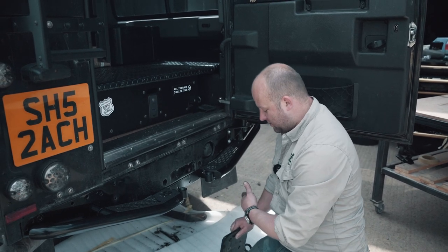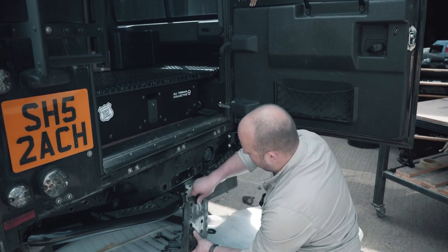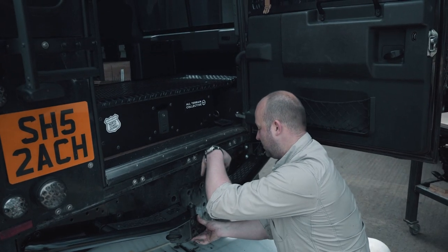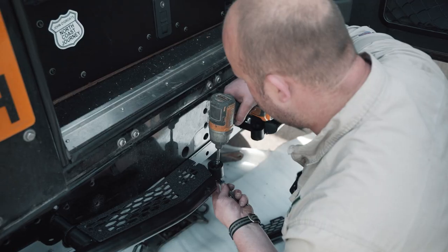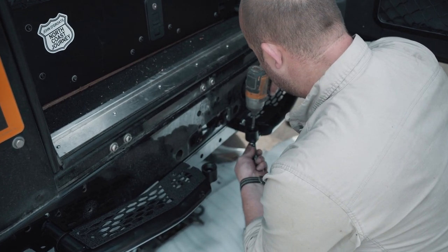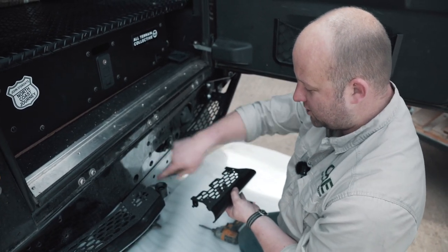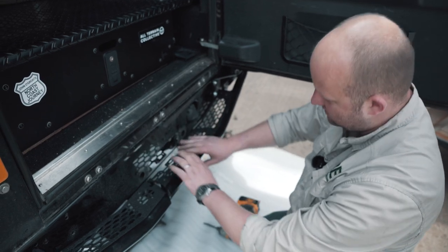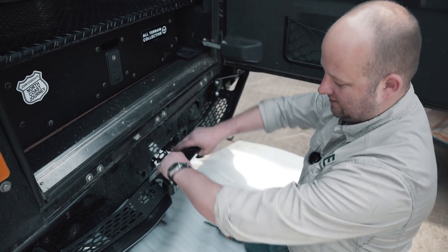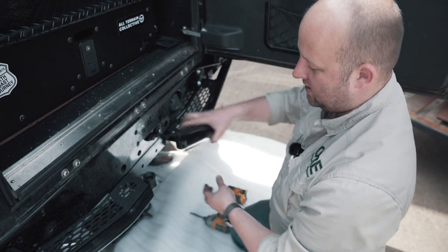If you put the factory tow system back on, your stays would still be in situ and you would simply put the bolt you took out back in exactly the same places, and the centre section will fit in around this. When you've set the slots — females this way and males that way — just gently nip everything up, don't over-tighten anything. It should pop in and out smoothly. A little bit of grease in here helps as well.